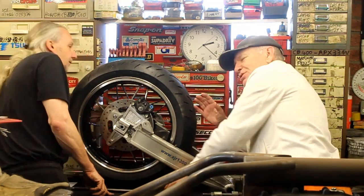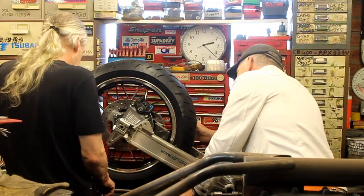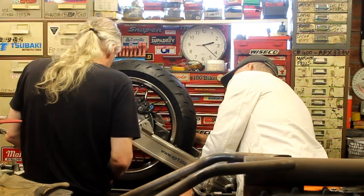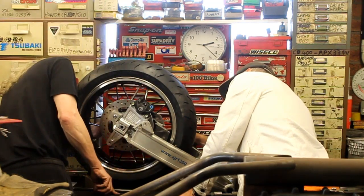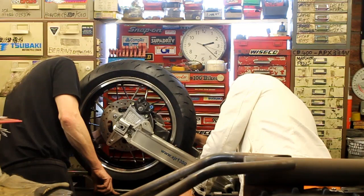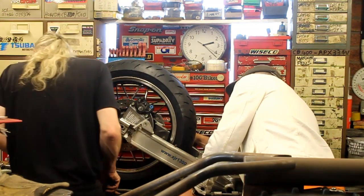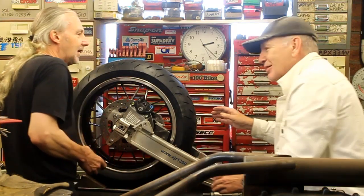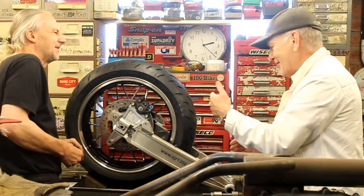On this side, you can see how close. We've got not a problem as such. I can't really show you, but the studs of the sprocket carrier, which hold the sprocket in place on the carrier, are probably within 5 mil. Well, no. If you look at the end, yeah, I can see. Maybe 2 or 3 mil. 2 or 3 mil in places. You don't want to go any closer. We can't move the wheel any more this way.